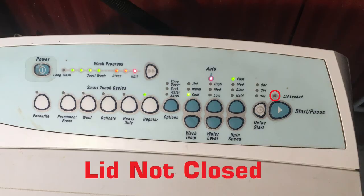Finally, if the lid lock light is flashing it means the lid is open — simply close the lid and the machine will lock it and continue with the cycle. It's very rare that there's actually a lock fault causing this code. I hope that's helped. If you've got any questions, ask in the comments and I'll try to help, and I'll be back in the next video showing you how to read the other style of fault codes.